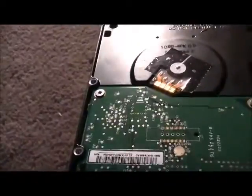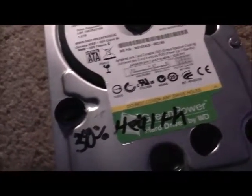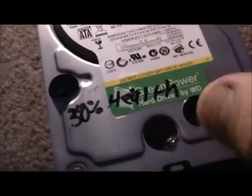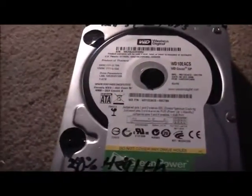With Samsung, Toshiba, and Seagate hard drives — no heads — they will just keep spinning. But with Western Digital drives, the firmware turns them off so they will not keep spinning. If there's a major problem with the heads, it will spin up, click a couple of times, and turn off. So if you want to make massagers out of hard drives, it does not work for Western Digital drives — their firmware works differently in failure conditions.